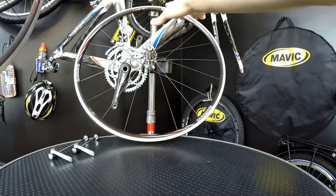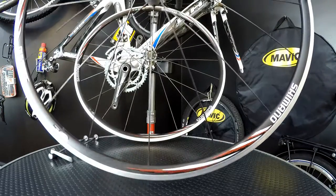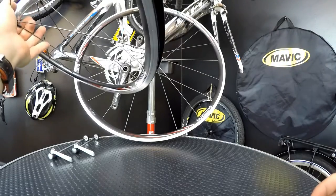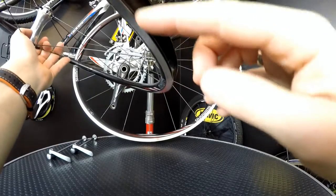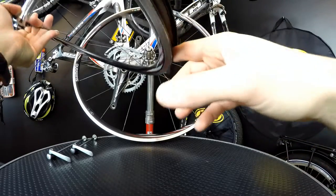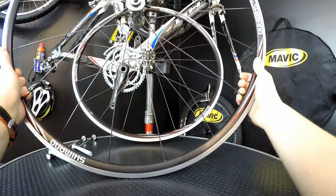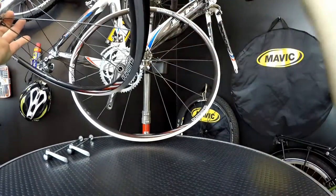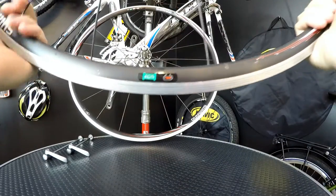It depends largely on the condition you're going to buy these wheels in, but these we bought with this cool BH aero bike and they're in great condition. I'll show you a couple of features. One thing we don't have on these 6600 wheels that the 6700 and 6800 Ultegra do have: there are holes here in the inner walls, meaning there is no tubeless-ready system on this. That means the rim is lighter, and you can use rim tape for this purpose.